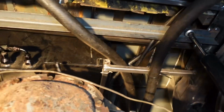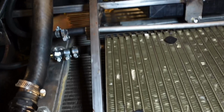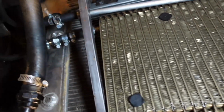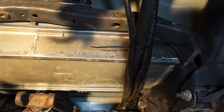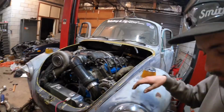So got that done. We got the radiator mounted as I showed you, the battery mounted, and we got the trans cooler mounted. We had to do a bunch of adapting because this is like a diesel cooler. So don't look at all those hose clamps, but it'll seal and it's fine. Got our trans cooler and coolant lines routed, mostly zip tied out of the way. Still need to trim some ends obviously on the zip ties, but got that routed pretty well.